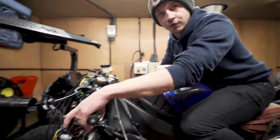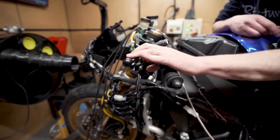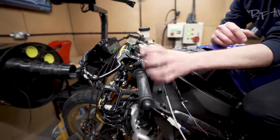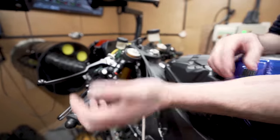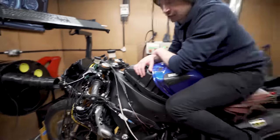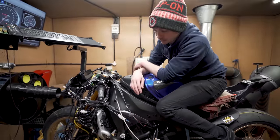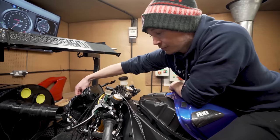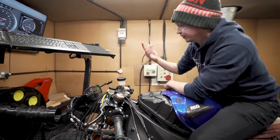So HEL rear brake, scooter brake, same as the others, the clutch is stacked up in the air. The buttons are slightly different because they have to be for the road. The superbike electronics are Motec. This is still on full road electronics. So literally just unbolt all the lights, even down to there's a flapper delete in the front that these guys print in-house to delete the air flap in the front.